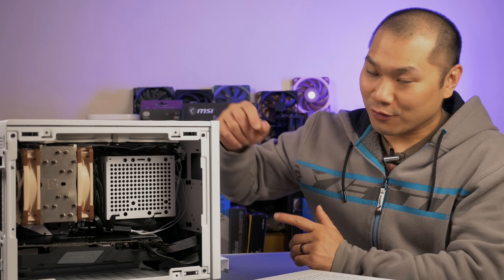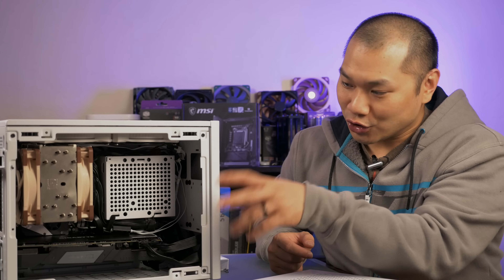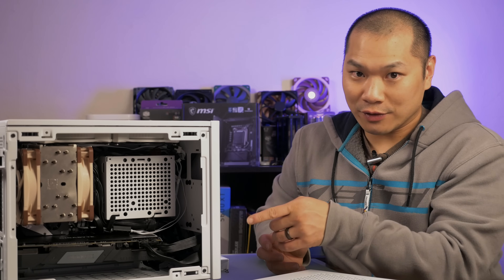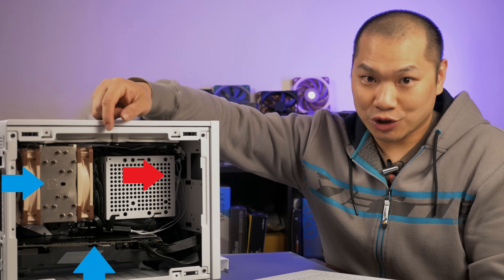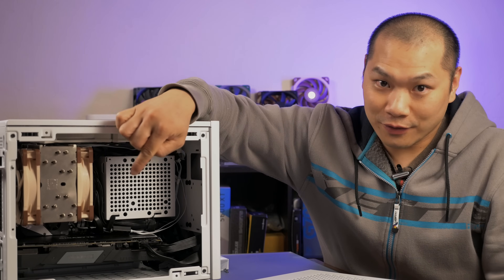With a higher powered GPU, the cooler might be capable of exhausting heat from the card, but your case still has to get that exhausted air out of the vicinity of the card. Otherwise, it's just going to slow cook itself in that ball of exhaust air. If we take a look at the test with a 2070 — which I have in this case now, running at about 175 watts — the rear intake with bottom fans is a pretty good configuration. The bottom fans help ventilate the GPU while the CPU tower can take in cooler air from the back of the case. This is especially important for a card like the 3080, particularly the Founders Edition, since the FE card puts its exhaust directly into the path of the tower cooler.